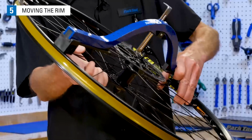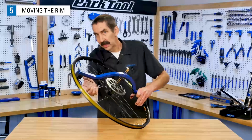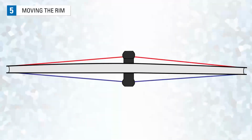Squeezing a pair of right side spokes near the dishing tool foot moves the rim, much like tightening all right side spokes. We can see the gap getting smaller. That tells us tightening the right is the way this rim needs to go. To move the rim relative to the hub, we use changes in spoke tension from one flange.